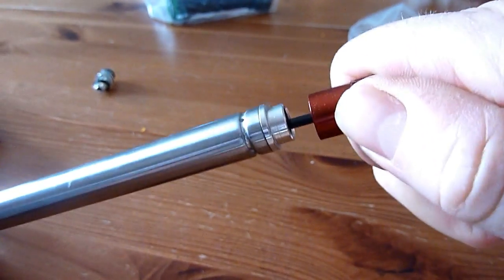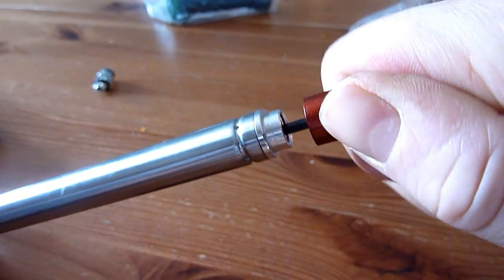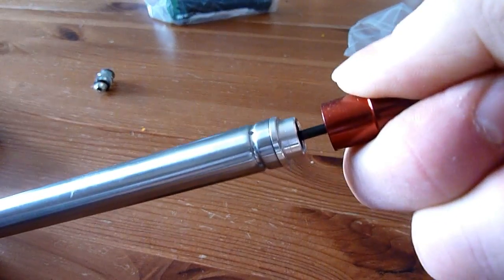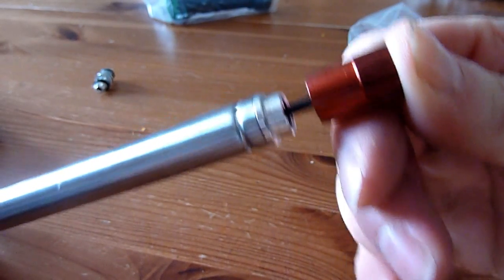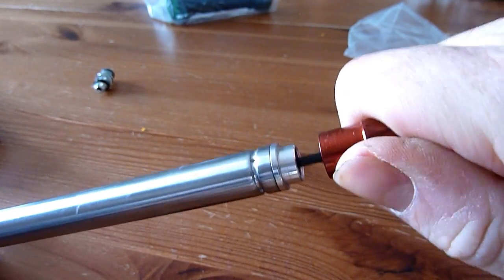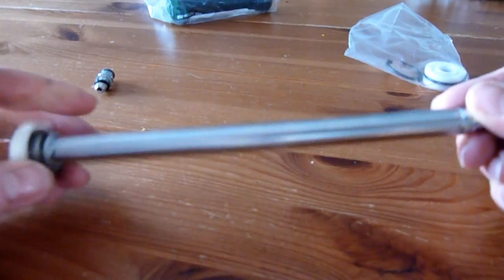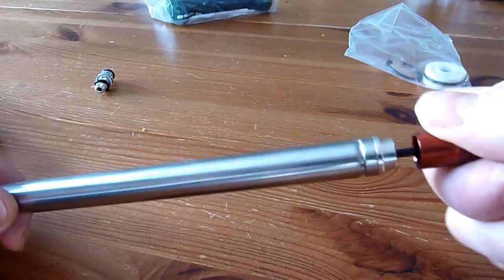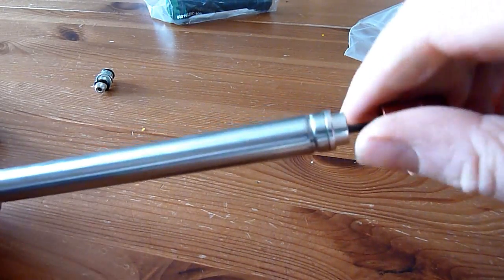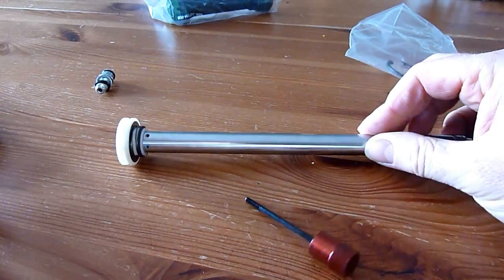So it's all the way out - at its fastest damping. Then we'll push it in and twist - maybe over 90 degrees of adjustment. Screwed all the way in so you can't push it anymore - that's as tight as it'll go, giving your slowest rebound. We're actually going to fit this new one, and when we fit it we're going to make those 100mm shocks 120mm. That's it - your damper lesson over for today, hope you enjoyed it.